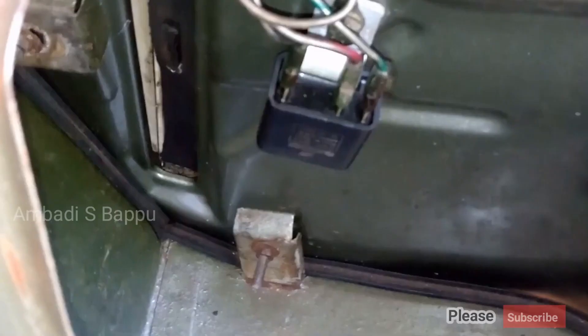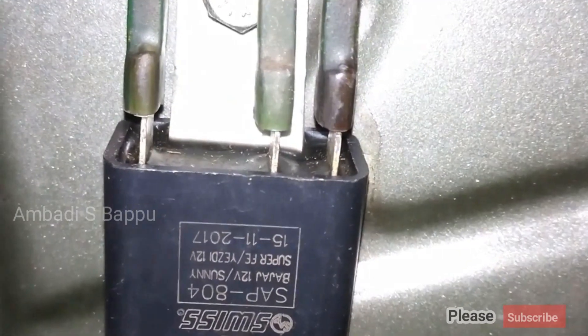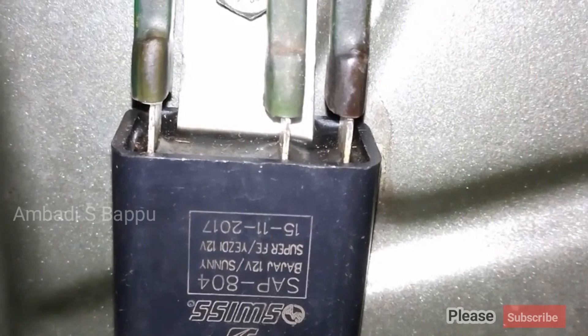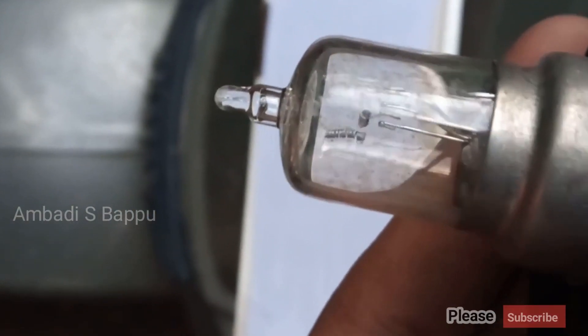While opening it, the unit showing here is the regulator unit of this scooter. The function of the regulator unit is to regulate the voltage below 12 to 14 volts from the high voltage obtained from the coil of the engine. If this regulator unit fails, the high voltage from the engine will directly go into the headlight bulb of the scooter and the bulb fuses regularly.